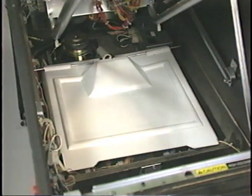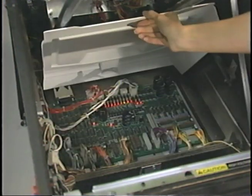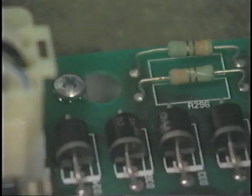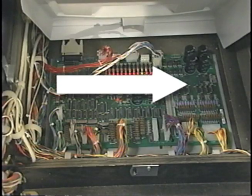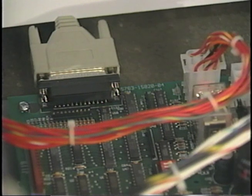This is the new Pinball 2000 power driver board. This board contains 22 fewer connectors than the previous board. It is held down with only two screws and uses a unique slide mounting system. The board's non-removable cover is designed so it cannot be left in the open position. The parallel port is located here. A laptop computer can be hooked up to this port so you can access powerful diagnostic tools.